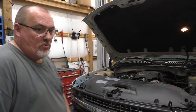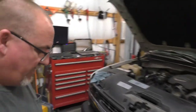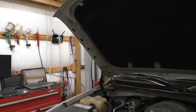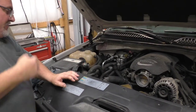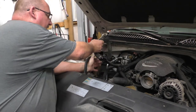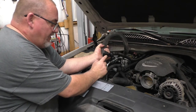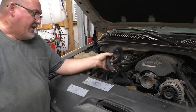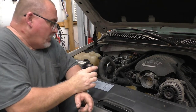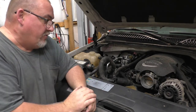This is a 2002 Chevy Silverado, and regardless of the engine in it, what's going on here is the customer just asked me to check out his coolant leak. A common thing to happen on these trucks — and that's really why I decided to go ahead and post this video — is this fitting here. It's a Y adapter. These get brittle over time and they'll end up leaking.